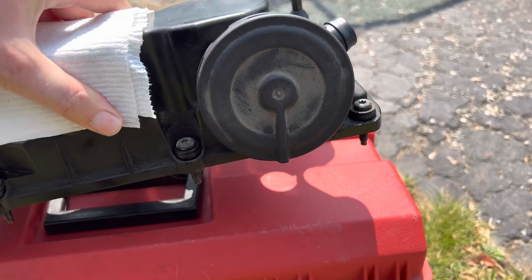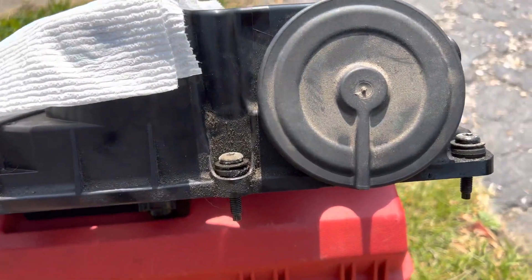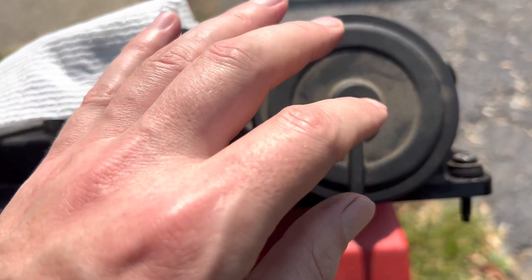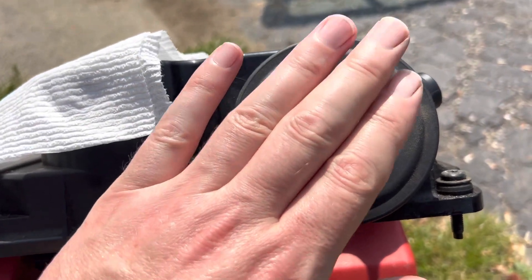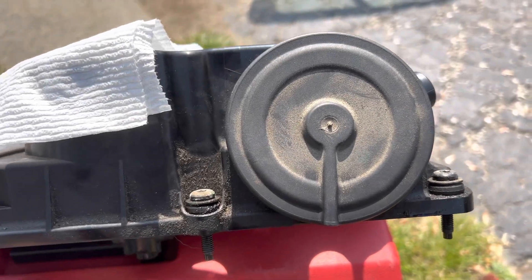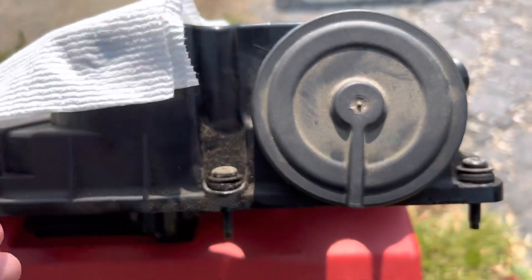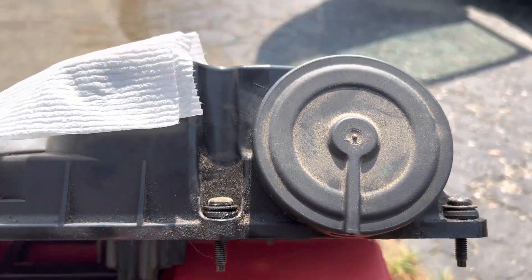Another thing is these supposedly tear a lot. When they tear, it's just going to be open — any tear is going to allow that positive outside air pressure to just go right through it. It's not going to be able to hold the diaphragm down and closed. Basically when it tears, it's never going to close. So you'll have constant airflow from your crankcase into your intake.